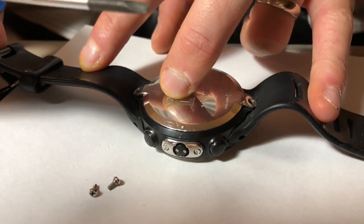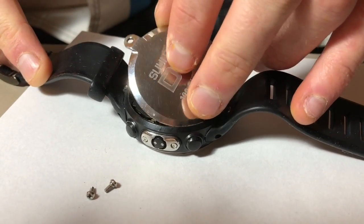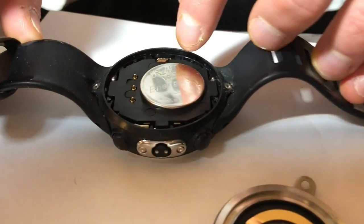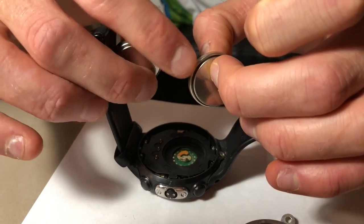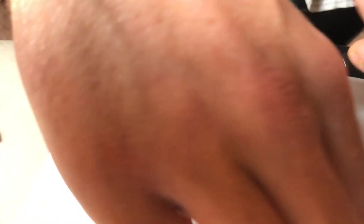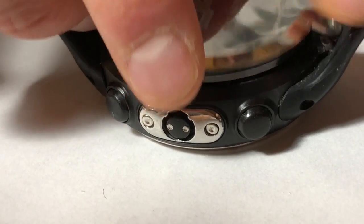Take your flat screwdriver and just pry up the back — it opens up nicely. You'll see in here there's our old CR 2450. That one can come out — that's our dead battery. You can see it's the shallow-set one as compared to the deep one. If I try to put the deep ones in it doesn't even push down far enough and I won't even be able to get the back on. It's at least a millimeter too tall, so these ones are junk.